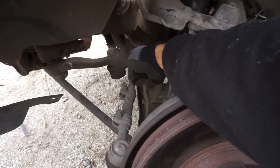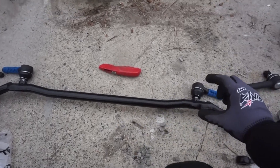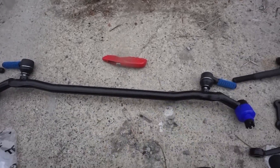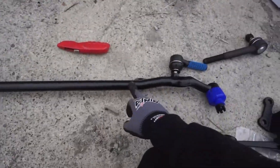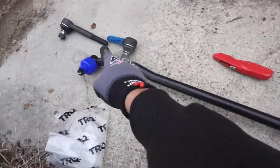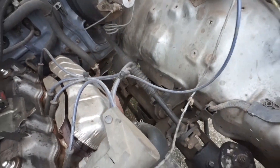For those of you not familiar with linkage steering: instead of a rack and pinion — where you have a pinion and a rack with grooved teeth that ride along the pinion to go left or right — this setup has a Pittman arm that comes off a steering box, which turns a drag link. Then you have your inner tie rod, outer tie rod, and a sleeve coupler that holds them together. Here's the steering box with the steering column coming all the way from the steering wheel. It's a pretty archaic setup, like older muscle cars. Without power steering it can be a pain in parking lots, but once I replace everything it should have a nicer, stiffer feel.